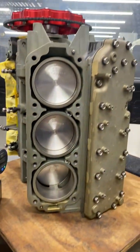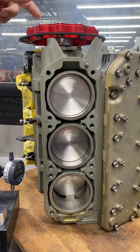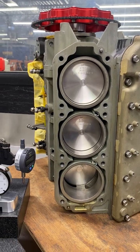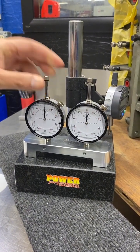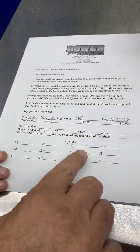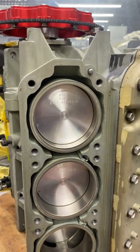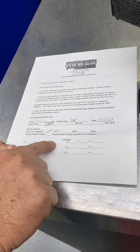We're going to proceed to turn the flywheel. I'm going to set the bridge tool over the deck, over the sleeve here, and rotate the engine until we find the highest point. I'm going to add the two indicators together — in this case just as a demonstration. If that was 20 and zero, the average stick-out would be 20 and zero, so the average would be 10. On the sheet, you simply put the cylinder number — in this case cylinder number two — and write the height of the two indicators divided by two, giving you the total in thousandths.